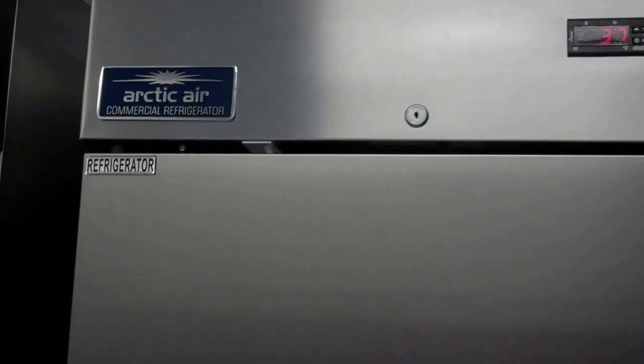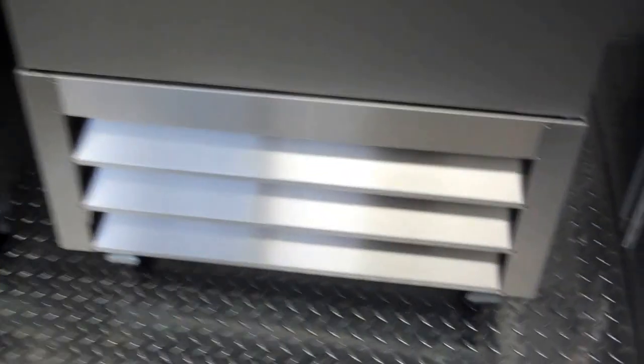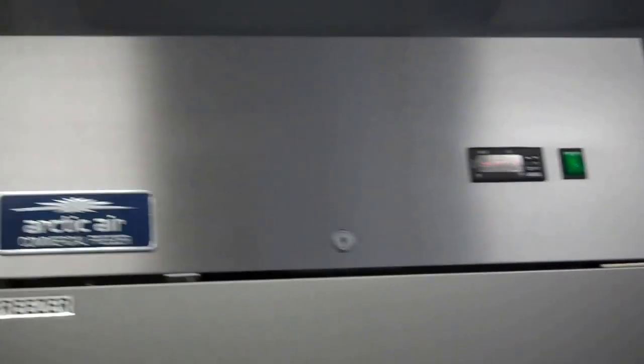There's your tie-downs for your refrigerator and freezer. Electronic controlled — that's your refrigerator. Locking wheels — roll it out and clean under. Health Department loves that. They're both 23 cubic-foot uprights. This one here is running. I believe there are four racks. The freezer here has not been turned on, but it gets cold real quick. It also has a self-closing door — that way you don't have to worry about it not being closed, and that's another thing the health department likes.